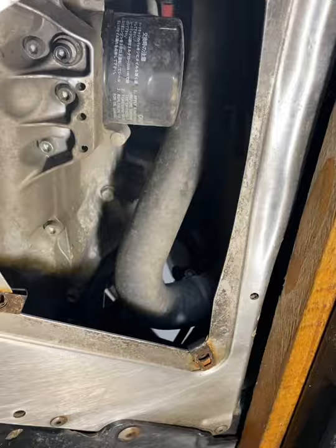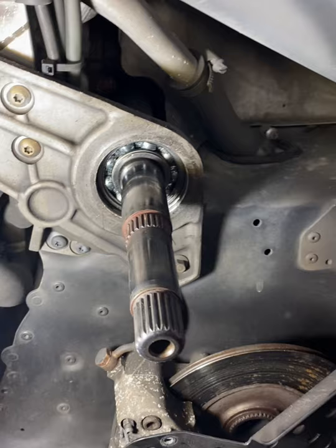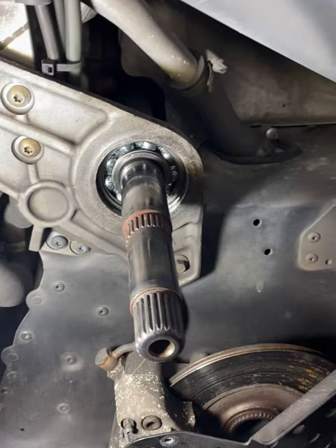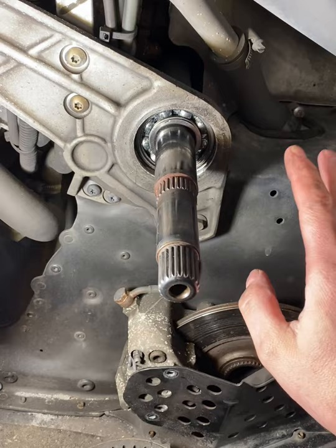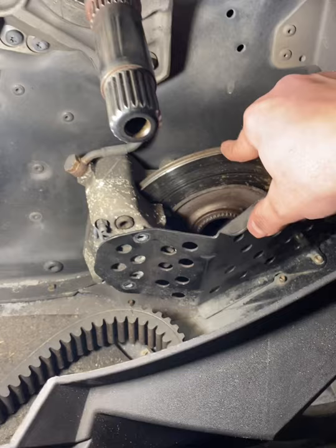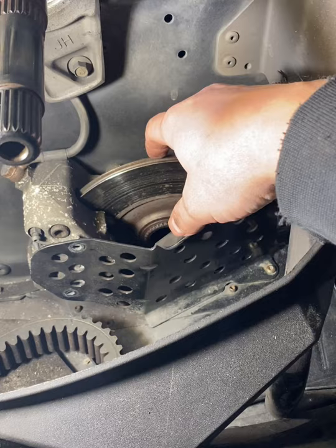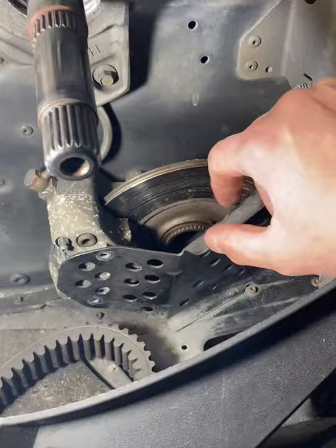Now back over at the clutch side — there's a snap ring in here. I've popped that snap ring off and pulled the seal off this bearing. It's a good way to inspect the bearing for failure and to re-grease it. Some guys spray it out with brake cleaner and put new grease in. I'm also going to remove this guard, split the brake caliper in half, and actually remove the rotor. These machines are known for this drive shaft wearing because the bearing is not actually fixed on the shaft — the tolerances are kind of loose. The shaft may spin at a different rate than the bearing and eventually wear the drive shaft down.